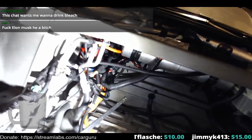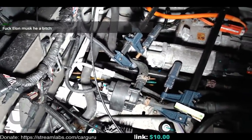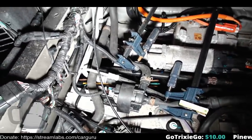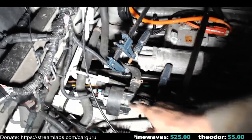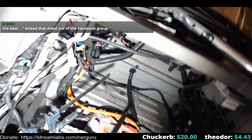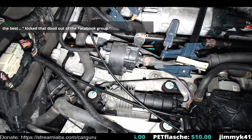This is the culprit that I haven't been getting any feedback from. When I put my hand on it, it doesn't move at all. But the cool thing is that you probably can't hear it now because it's pretty much silent at this point. But once you disconnect a coolant pump, these other pumps right here, like this pump and the one back there, spin faster. So that's what Tesla designed in as almost like a fail-safe to make the car easier to use.